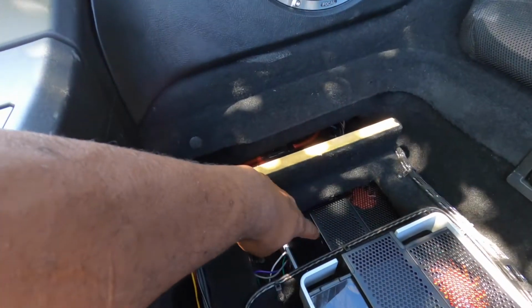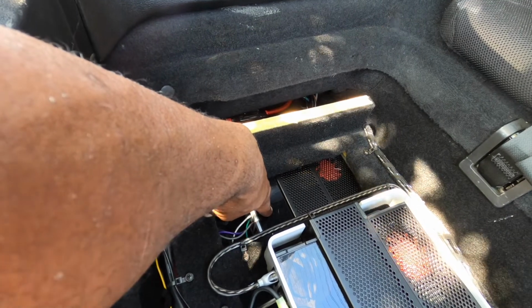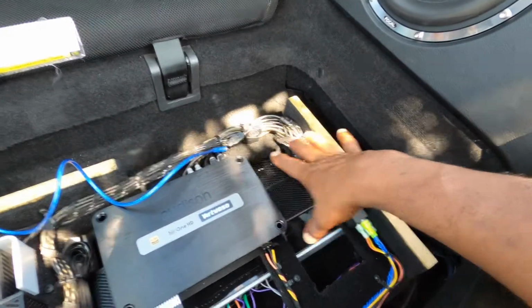So the whole system is basically Utopia. So 3-way front, tweeter, mid, bass, 8s in the doors, and a 2-way rear, 6.5 and tweeter in the rear, and everything's fully active. So in this system, this particular amp is running the front tweeters, the front mid, and the left mid bass. That's 1 5-channel, and these are all going to be the Mosconi amplifiers, every one of them.